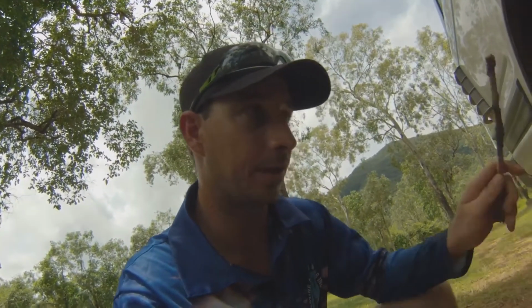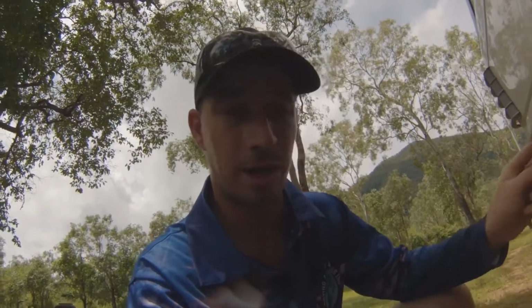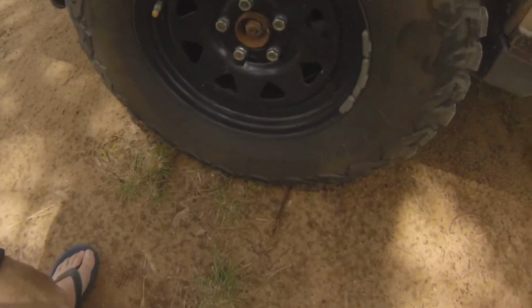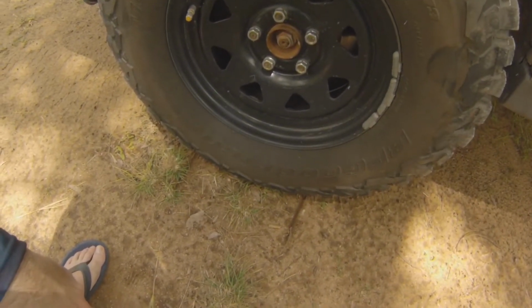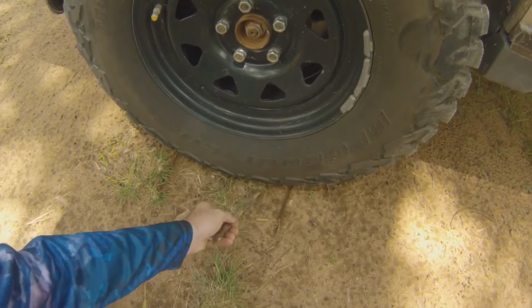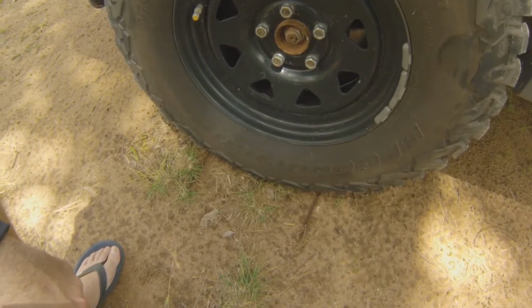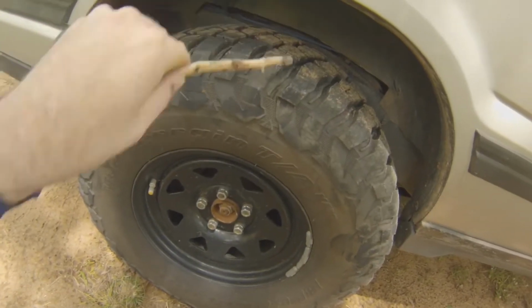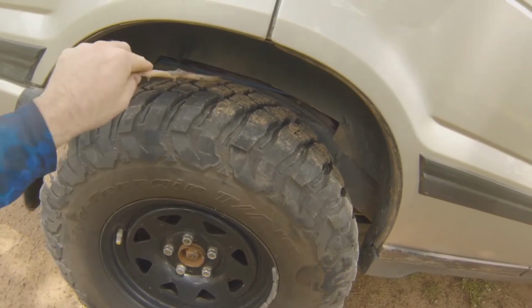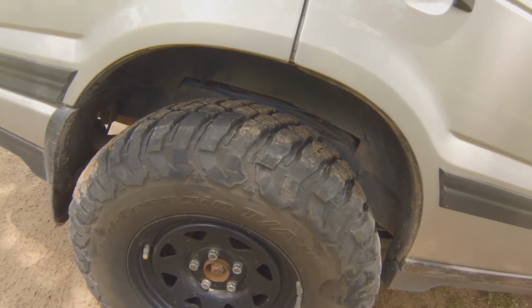So that's a pretty decent contact patch with the road, given that this is a 285/75/16, a big 33-inch tyre. That's pretty impressive. I'm running with that much tyre on the ground, just around town on the highway, at a width of almost 285, because these sidewalls are included in that measurement. So that's a lot of tyre, and you can understand why big tyres, especially the mud terrains with these large tread gaps, make a lot of noise on the road, because as you're driving along, these little tread blocks squirm a lot, and that's what makes that noise.